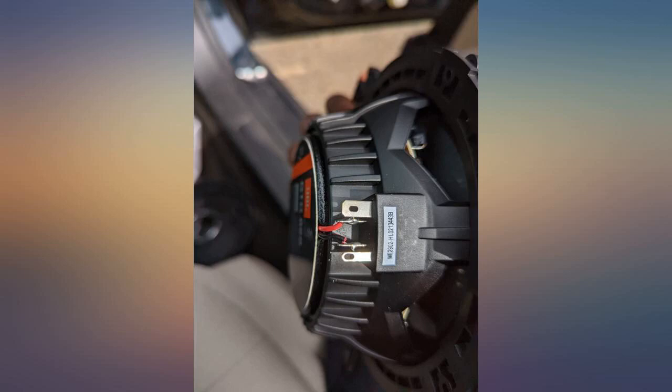The Amazon description says they do not fit a 2016 Subaru WRX, but they worked for me with Metra's speaker adapter. As you can see in the pic, I had to drill a hole to allow access for OEM wiring in Metra's speaker adapter. It also appears that 1 out of 2 supplied brackets might work as well with the modified hole for OEM wiring. I held it up to the speaker in the pic but didn't install. Holes do line up. It's nice to be able to rotate the uni-pivot tweeter for directional preference, since the Metra adapter can hinder direction. As far as sound, it's quality, but time will tell on durability.